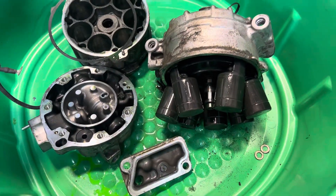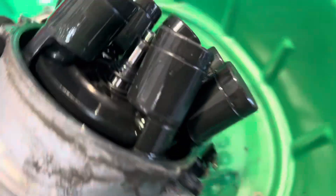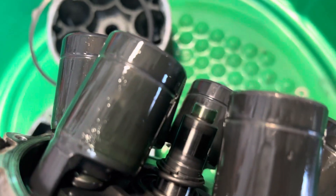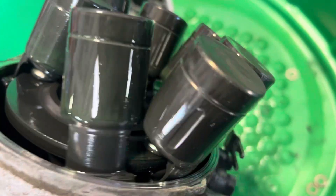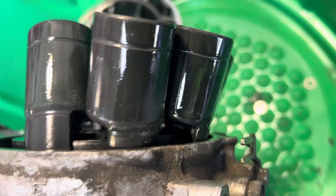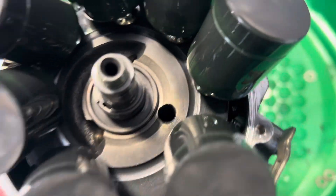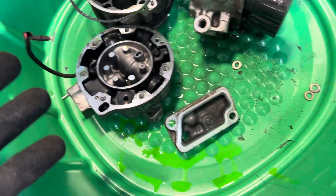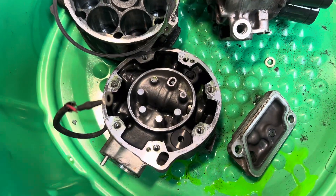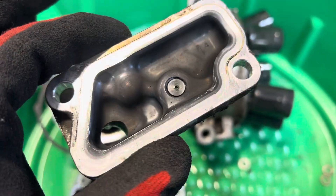I always love tearing apart stuff, and this is a failure on this Mercedes. You can see a little metal debris on there — very little. They don't have the old piston ring material because the body itself and the oil film is your ring and your sealing surface, and you can see they do freely move around. He said he tried to pour it out and no oil came. I put brake clean in here because I was looking for debris to pour out — debris did not pour out, and it looks dry because of the brake clean.